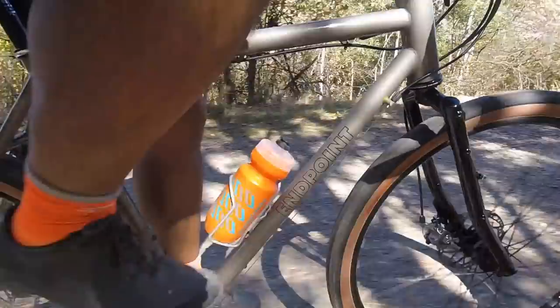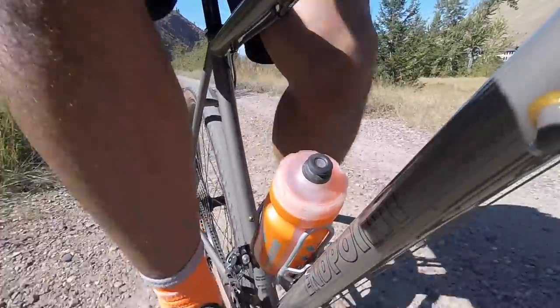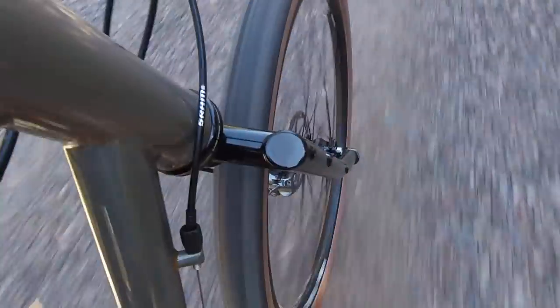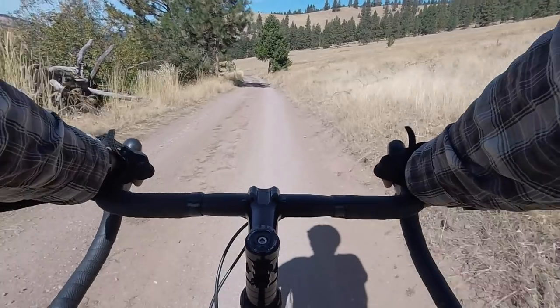Starting from the rear, this bike is fast. If you like bikes with a short rear stay, you will love this bike. The rear chainstay is 418mm — that's a pretty short chainstay. The way that affects the ride is that it accelerates really quickly; it feels like the bike just wants to get up and go. When you're climbing and putting power to the pedals, the bike surges. The whole experience on the rear is one of making you feel fast, even though you might not be that fast — it just feels so responsive. On the front end, the fork is a low trail design, which if you've not ridden one, it takes about 20 minutes to get used to. You'll notice some strange steering dynamics, but your body compensates. In some ways it feels a little bit more overly responsive than typical mid-trail steering, but after a while it just felt natural. The front end matches the rear end pretty well, making for a nice, tidy, short wheelbase, short chainstay, responsive handling bike.